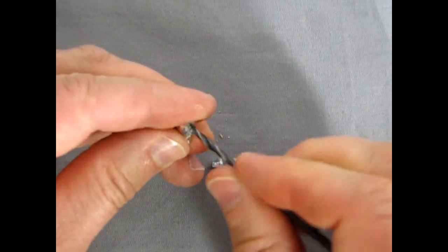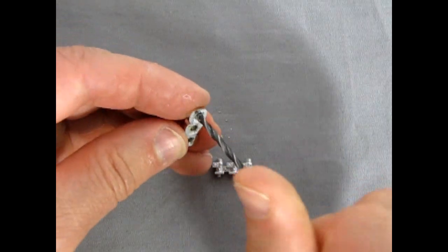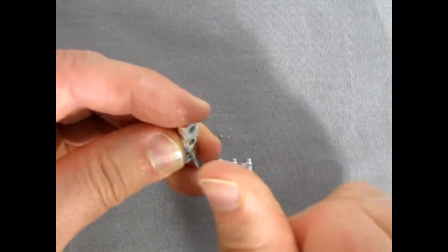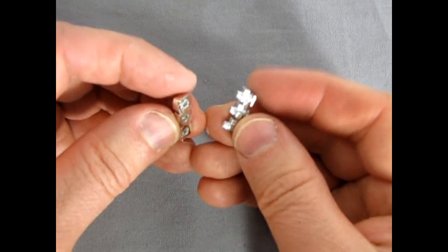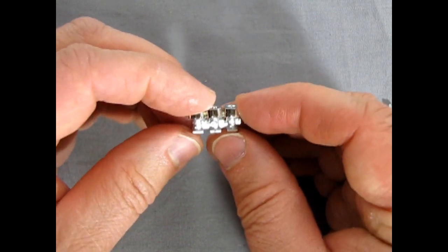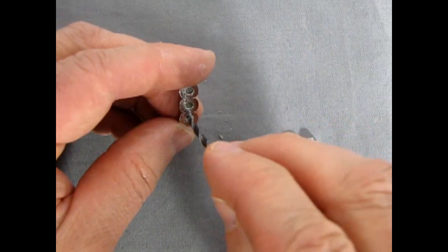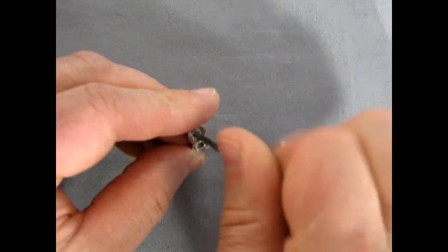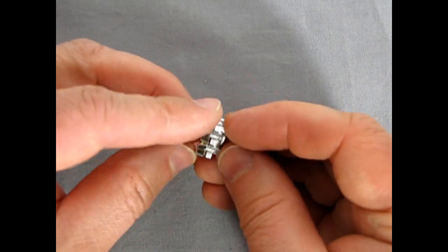So yeah, just with fingers, because the mission is not to go through the top of the carburetor heads. Or sorry, the air cleaners. The mission is just to clean it up inside enough so that A, you're getting rid of the chrome in here to a degree, and B, you're going to make it sit flat on the carburetors. So here's our carburetors here, and now you can see we got a nice flat fit and finish on there. If it does look a little bit lopsided or sloping down, you can always just twist a little more in here, slowly, until they seat nice and perfectly. Just like that.